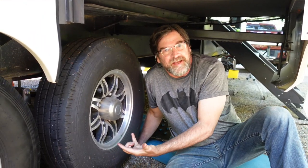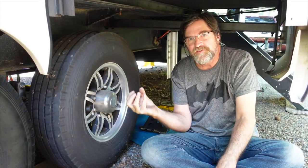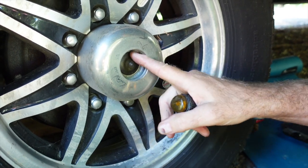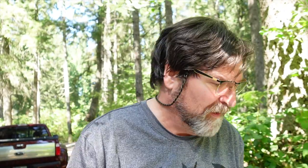The reason we're jacking the axle up is to lift the wheel off the ground, because while we're filling the bearings with grease we're going to be turning the wheel counterclockwise, and that helps distribute it throughout the bearings. To get to these easy lube bearings, you just pull off the cap and then there's another little rubber cap inside. Always have rubber gloves and plenty of paper towels on hand. We had a little trouble with the grease gun yesterday - twice we ended up losing suction, got air bubbles in it, and it quit distributing grease, so we had to rework it.